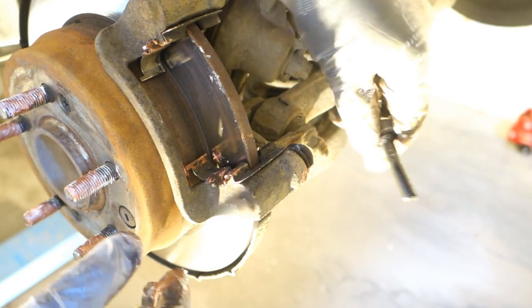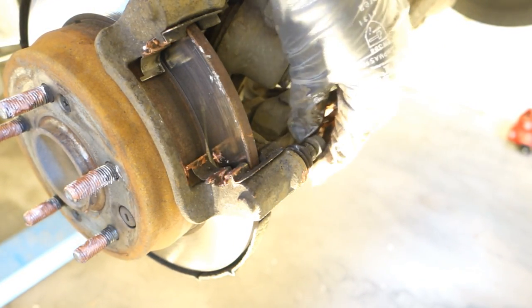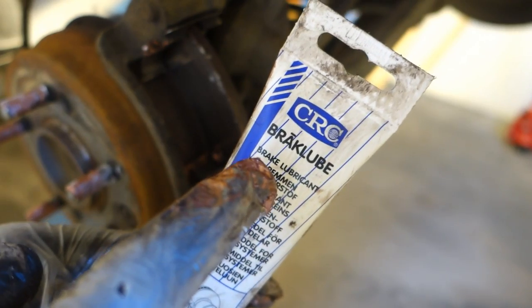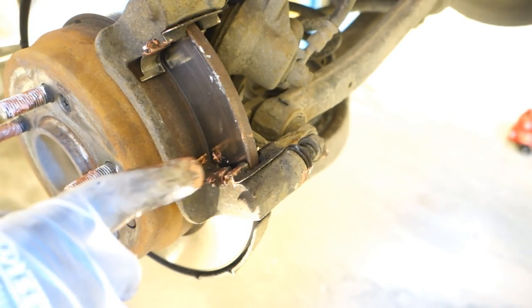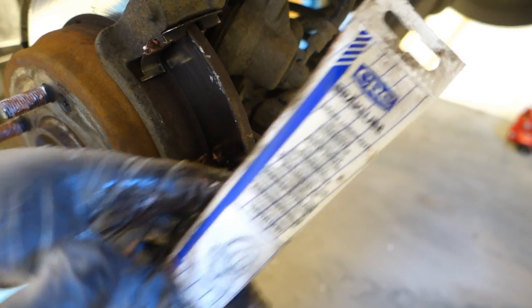Okay, now it opens, and there is this bolt, and this bolt, which goes in here, must be lubricated, so we need the next interesting thing. And this is brake lubricant, and this is then for all other things in the brake disc and brake pads area, where we can't use this copper paste and also this white metal-free paste. And this is suitable also for all rubber areas like this one.